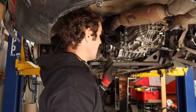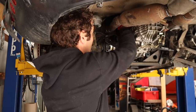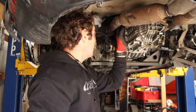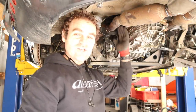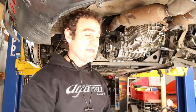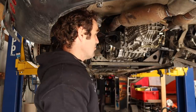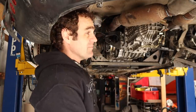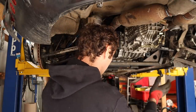I've now bolted up my tail shafts and drive shafts. The gearbox is bolted in. I put a couple of cable ties to hold the clutch lines away from the exhaust — they are close-ish, and I probably need to do something about some heat shielding there, but they're not touching, so we'll see how that fares. Continuing on, we need to start putting on some of the underside bracing again to brace this thing up.